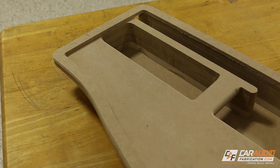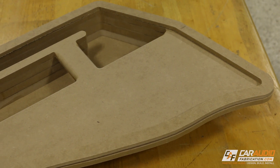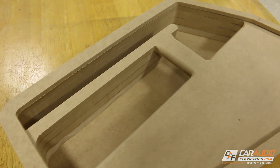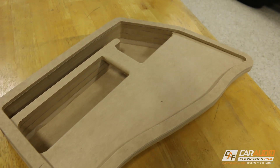If you were watching closely, you probably noticed I added a little bridge between the bottom part of the box and the port wall. By doing this I've added strength to the port wall itself to prevent it from vibrating. This brace is a great example of how you can change each of the different layers throughout a layered design in order to add different design elements.